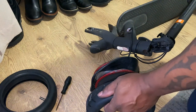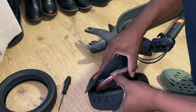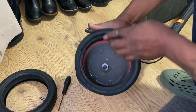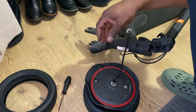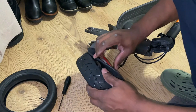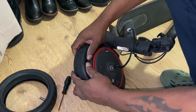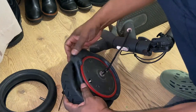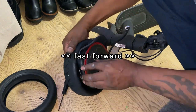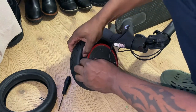So what I've got to do now is fit this tyre to the rim. Putting one side on is fairly easy — you don't need any tools. You can just push the wheel straight into the tyre like this. Make sure you've got it the right way around for the rotation. And then once that's done, it's just a matter of tucking the inner tube into the tyre. Here you can see me just tucking the inner tube all the way around into the tyre, making sure there's no folds. I managed to tuck the inner tube into the tyre after putting one side of the tyre on.